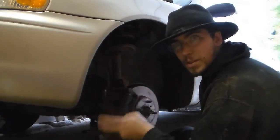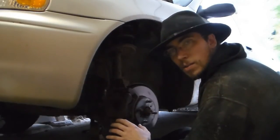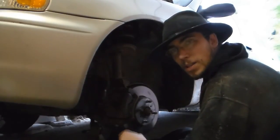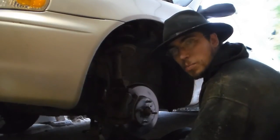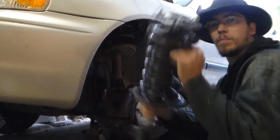The second helpful hint that I'll give you is that these Corollas are unibody frames with a floating front chassis, and if you jack up the car and you go to pop the hood and it doesn't open, it's because your unibody is flexing. Put the car back down and then pop the hood and then jack it up, just so that nobody freaks out. And I guarantee there's somebody who's going to smack themselves in the forehead and say, oh yeah, he warned me about that. So anyways, save yourself some time, buy a pre-made.